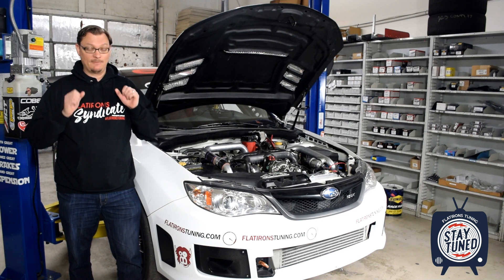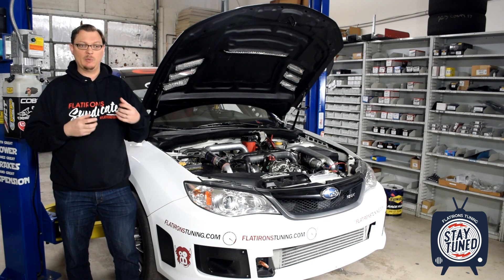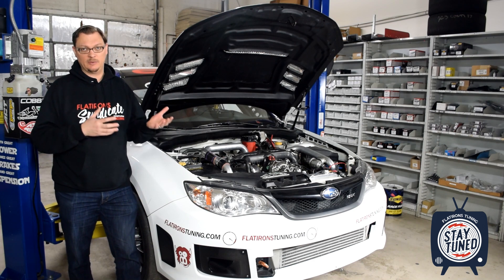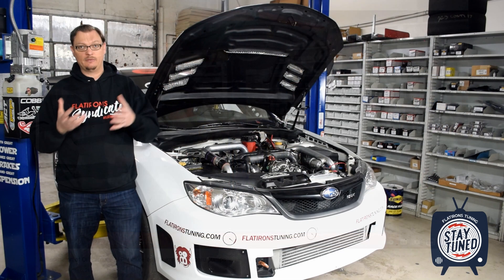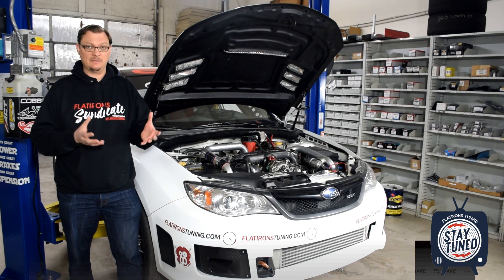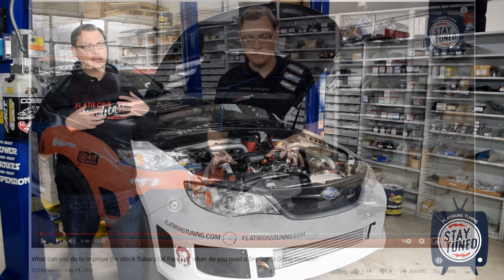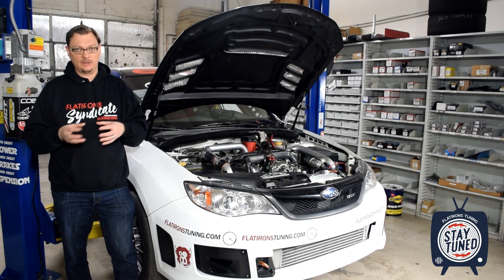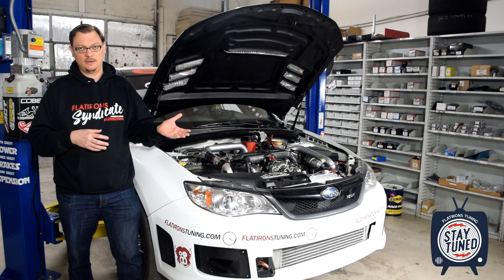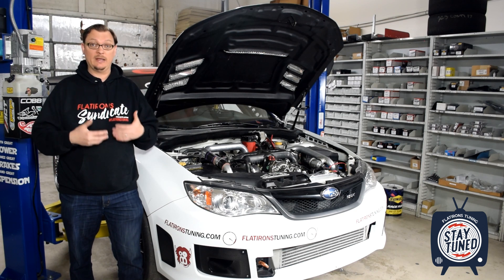The reason we put the dry sump on this car is because we wanted to have the most reliable oil delivery to the engine that we could. If you watched the video we made with Victor Koons from DM Rally and all the testing he did with the Subaru 10 and 12 millimeter pumps, and our initial dry sump video where we showed data that Roger Clark shared with us about an optimized wet sump system versus a dry sump system — we had a pretty clear picture that if we really wanted consistent oil delivery under any driving conditions or power levels, the dry sump system was the most reliable way to get there.